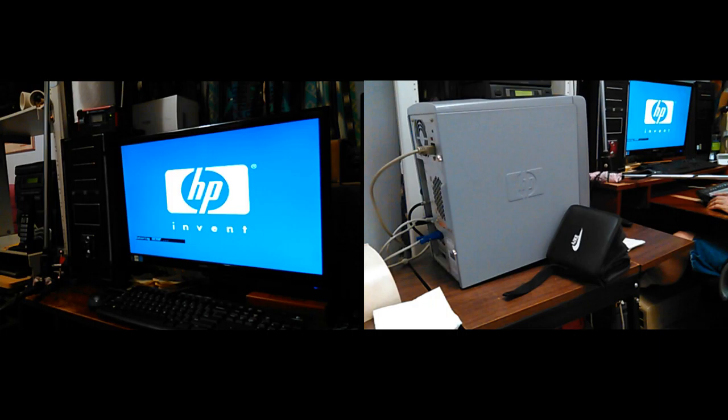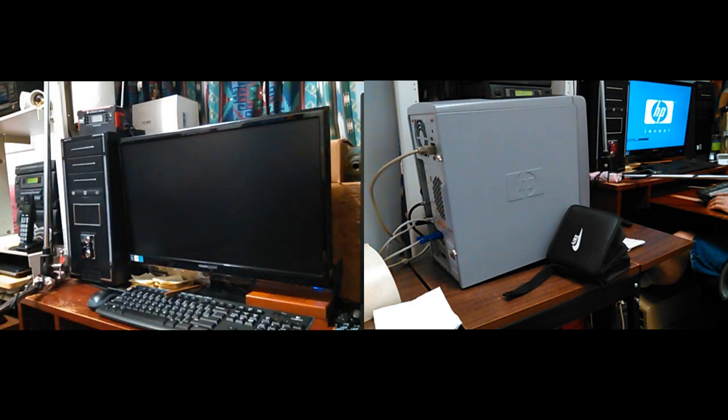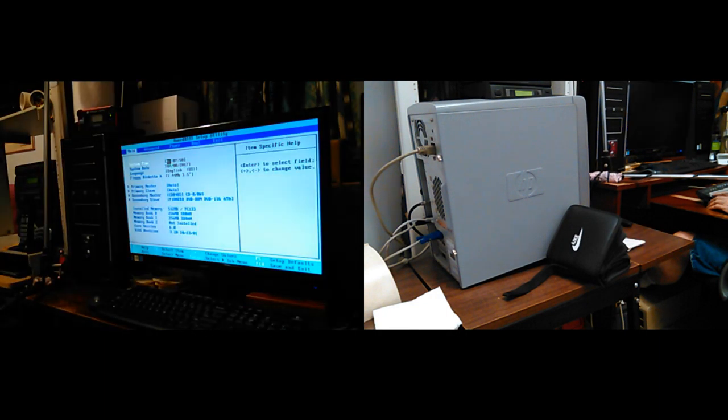It's got a back fan, CPU fan, a fan in the power supply. Oh, and I did feel the airflow. Stuck my finger in the fan by accident. I think you might have saw me jump. It's actually pulling in. The big fan in the back is pulling in, blowing towards the CPU, and the CPU fan is pulling, best I can tell. And so then I guess it's all dispersing through the case. That's maybe just as good a way to do it, blowing cool air in to the CPU.